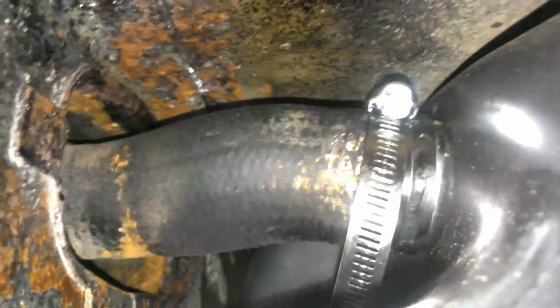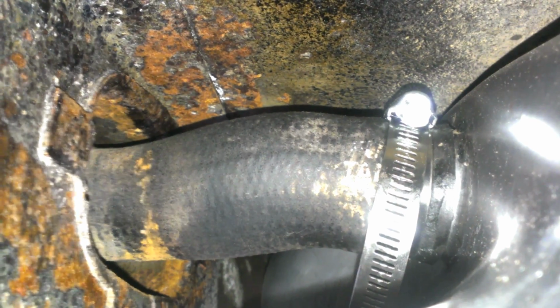So, besides that, the next thing that you're gonna try to do is squeeze your hoses into place. Now, if you notice that hose clamp might be a little big, it's more towards the smaller end of its tightening scale, but I put some WD in both the tubes to make the rubber hoses slide onto the fittings a little better. So have your hose clamps ready. Make sure that they point towards the top. If you look, you probably can't see it, I can't even get you back there, but the smaller tube also has the screw towards the top like that. So you're gonna have to tilt the gas tank back, do the little tube first, and tighten that up, then tighten up the top one.